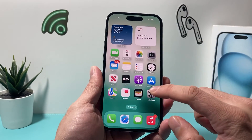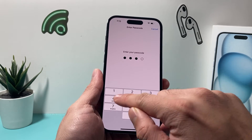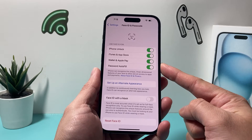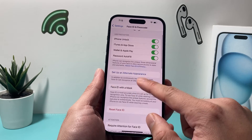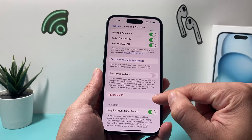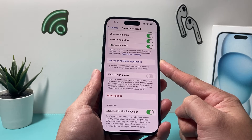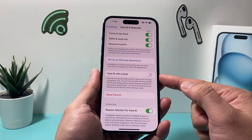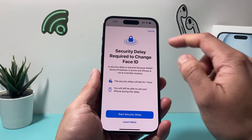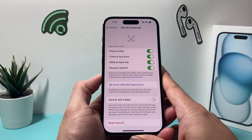You want to try to keep on tapping it a few times like this — now don't do it too hard, of course, you don't want to break your phone screen. So you do this a few times, and then go into your settings on your iPhone, go to Face ID and Passcode. After you have done that, ensure that Password Autofill is turned on along with all the other options as well. Then go ahead and reset your Face ID if you already have one. If not, that's fine. After you reset it, you're gonna set it up again. Another thing you could also try is setting up an alternative appearance — if you have glasses or something, you could create another one, and you can also use a mask as well. Go ahead and reset it and then set it up again. After you do that, try doing the tap thing again on the front screen — that seemed to be a weird bug going around, but it will help you fix that problem.